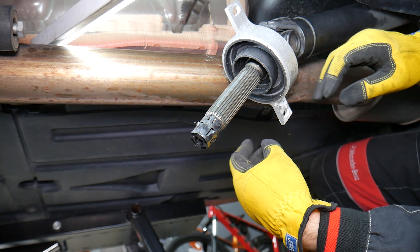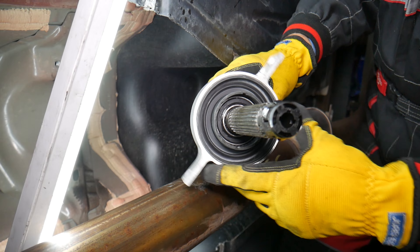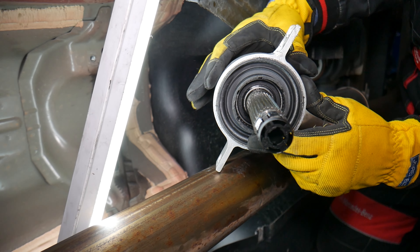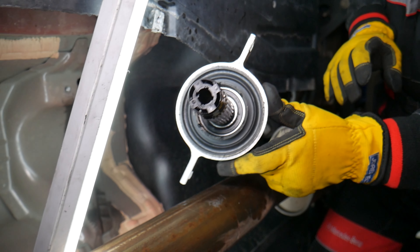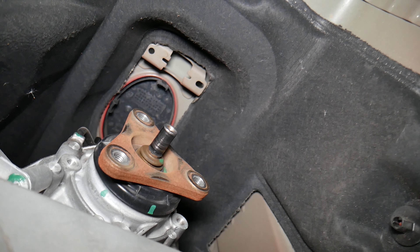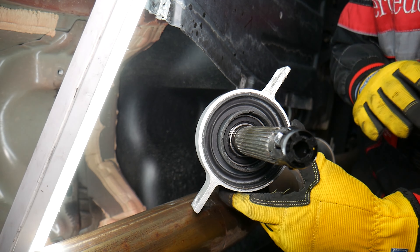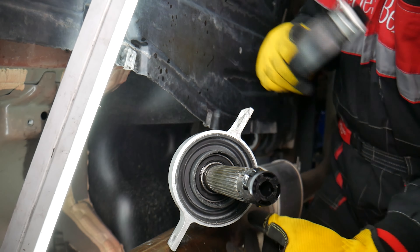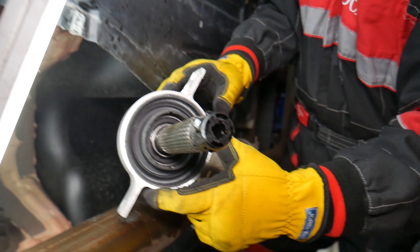That's it — the bearing is installed. Now we'll get some fresh grease and continue. The bearing is ready — that's how you replace the driveshaft support bearing on a BMW X3 or X4. Putting everything back together is the reverse of how we took it apart. I also recommend replacing the flex joint on the front that attaches to the transfer case since we already have it out. Make sure you align the two shafts to your marks so there are no vibrations. Hopefully the video was helpful — thank you for watching, see you guys next time.